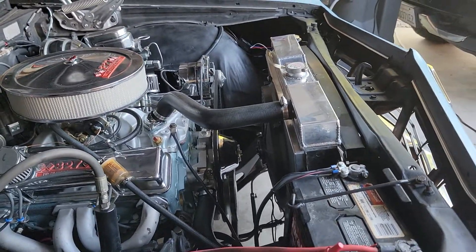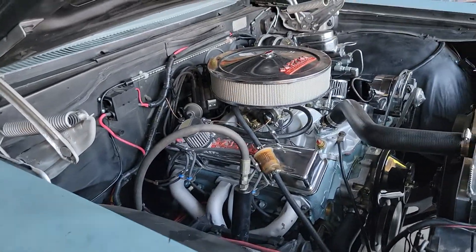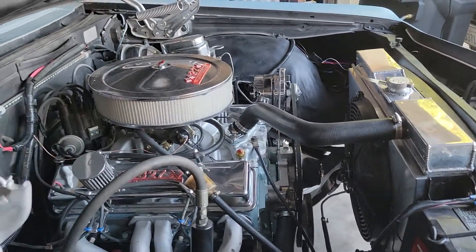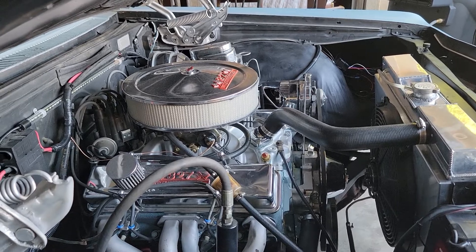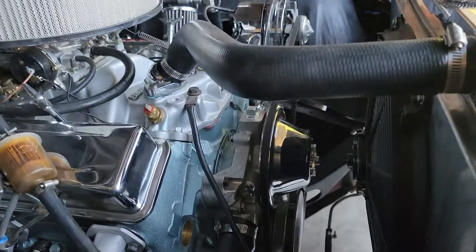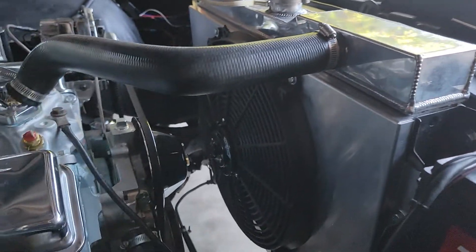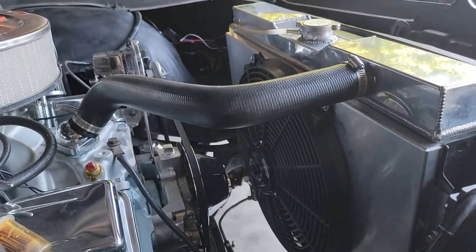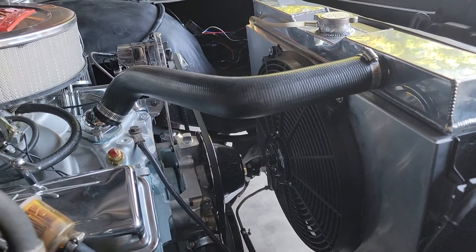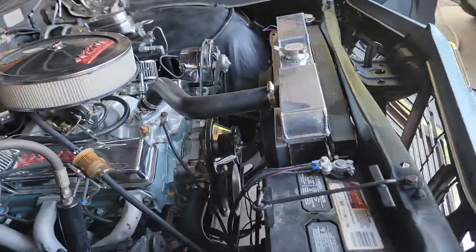It's been about two weeks since I threw a video out. I'm going to do an updated video on the upgrades I did. The motor's running good — she just started running hot, maybe because of the desert and because she was bored out 60 over. I got about 40-50 horsepower from that, and by removing the mechanical fan and running the electric fan I should get anywhere from two to ten more horsepower. I also noticed my timing might be off.